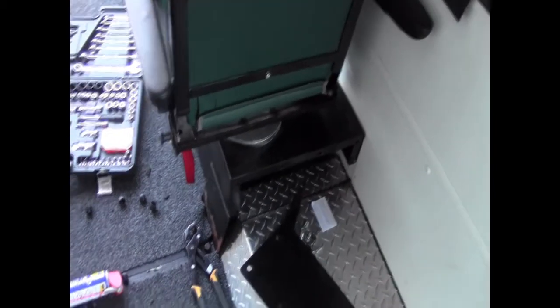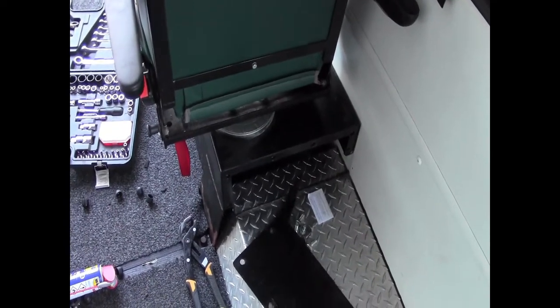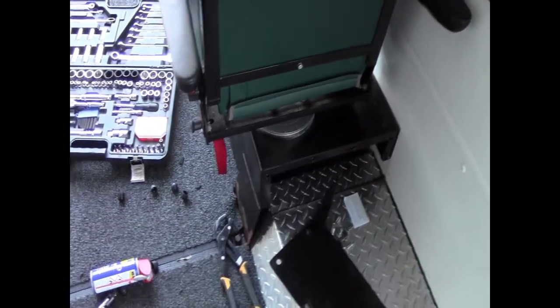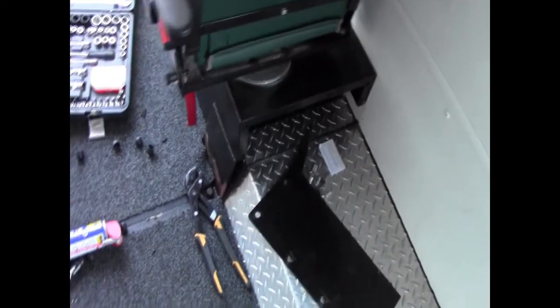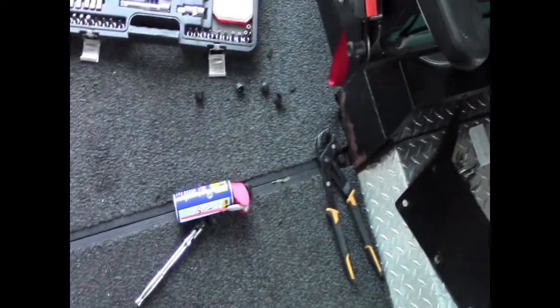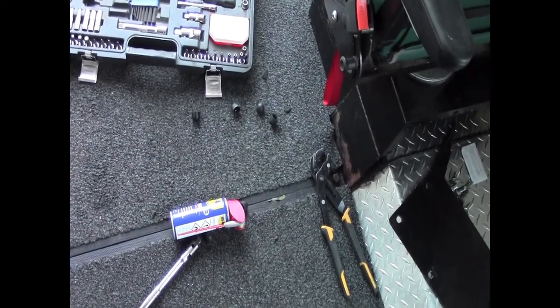Either that, I'll put a lever bar behind it when all the other bolts are off and literally lever against the nut — hopefully it'll spin off. I might even put a pneumatic nut gun in there. I've got an electric one but it's a bit vicious — it's like 200 foot-pound of torque and it's not adjustable, so if it catches on something it's going to break my wrists. I much prefer using air tools. The outside floor bolts are of course rusted, so I'm just soaking them, working them backwards and forwards. I know I'm using WD-40 and it's not a penetrating oil — tomorrow I'll have my GT85, which is a proper penetrating oil.